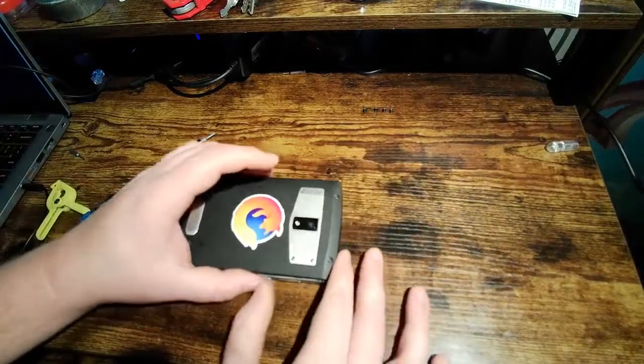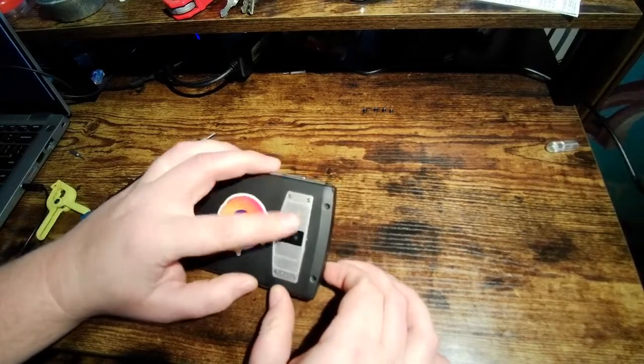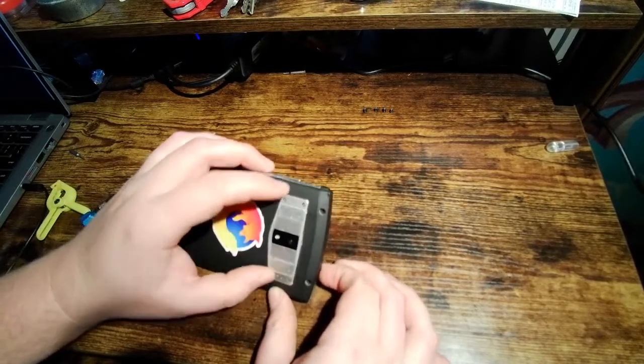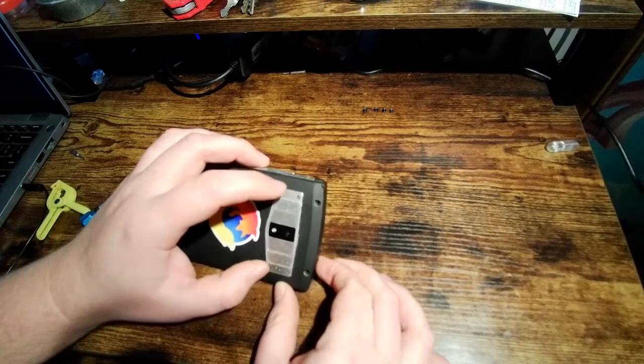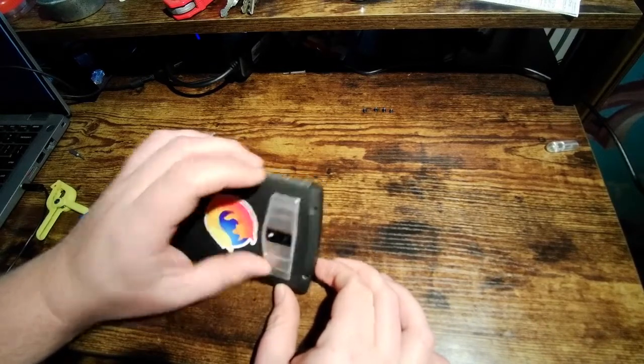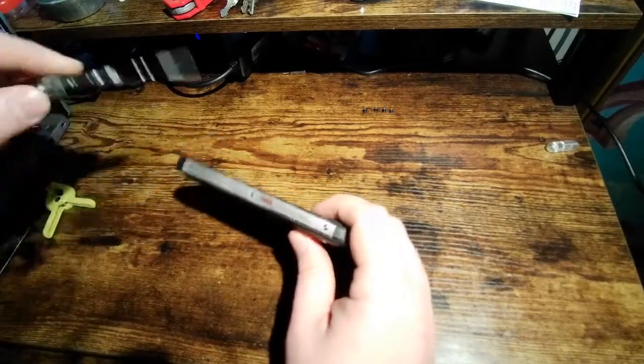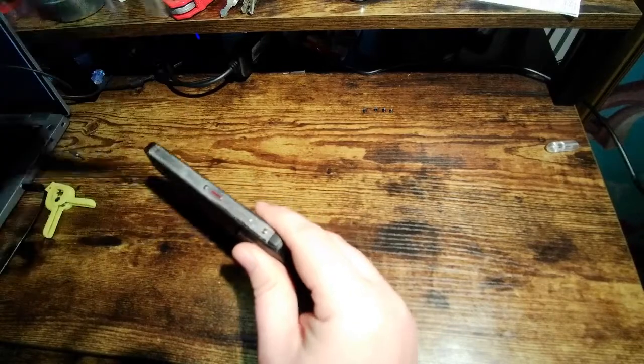Now you'll notice there's also four smaller screws right here around this little bezel. You don't need to take those off. Just leave those alone. They are actual screws, and I believe that I took them off when I first took this phone apart. I don't really remember. It's been a long time. I think this bezel actually does come off, but you don't need to take those out to take the phone apart. So next you're going to take these screws out along the side here, and I believe...